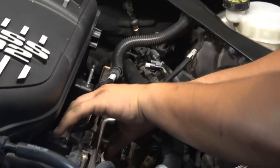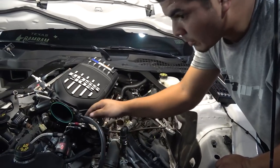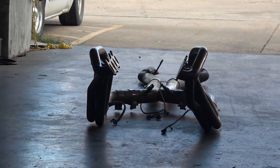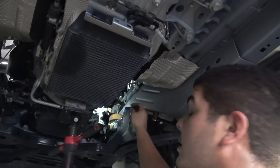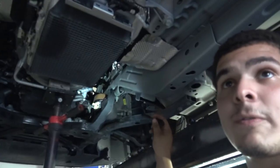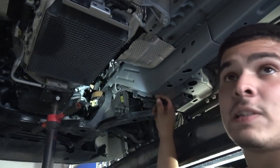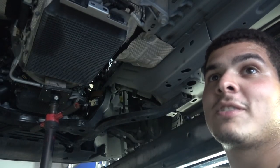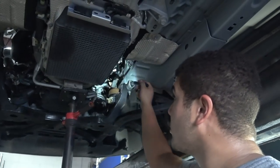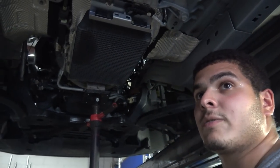This fitting doesn't have a quick connect on it. Now all we have to do is pull off this one little fitting right there and we can take the intake off. We've got to take off the AC lines so that the header can go through, and then it's going to have new AC lines — but we just got informed by On3 Performance that the lines they sent us, they sent everybody that ordered this kit, are for 2015 to 2017 cars. They don't work on the 2018 cars. So we're gonna have a whole turbo kit and everything and no AC.